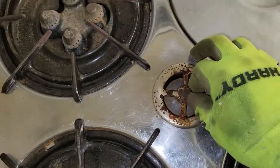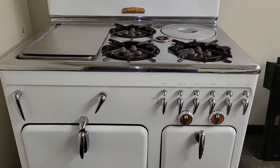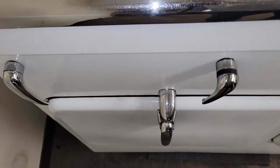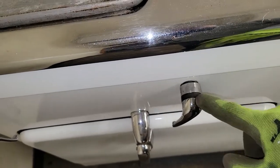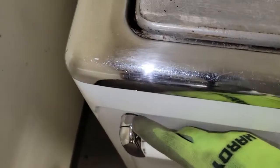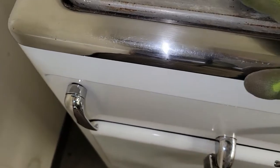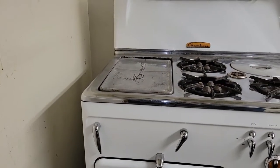The pilot light is present, and all the handles and knobs are present. Now we want to check to see if these work. Note right away — this is the original handle unbroken, with this piece of pot metal in between that was a terrible idea because it always broke. This is the same three-piece handle, but notice how it wobbles? The pot metal has broken. So we have a broken handle, and the griddle may or may not lift — that may be an issue with the handle or the mechanism for the broiler.